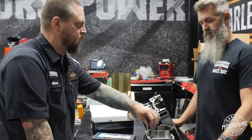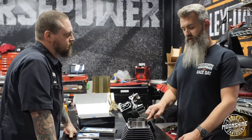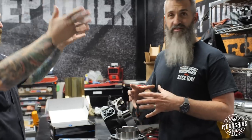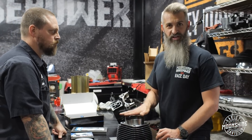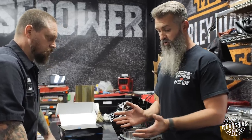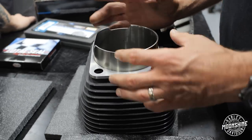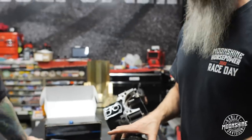I know they're using extremely hard metal which is how they make it so thin, but I'm one of those — it's been working for 70 years, why reinvent it now? Something we've noticed when we hone them: if we hone something with a really narrow spigot sleeve wall, the hone itself while honing is actually making it expand a little bit, so it'll be tighter and you have to machine it longer on the bottom in the final stages of honing. So when we do the 131 cylinders, we have a custom-made torque plate that is a real tight tolerance slip fit to the outside diameter of the spigot so it doesn't flex as much — we want to keep the flexing to a minimum.